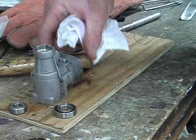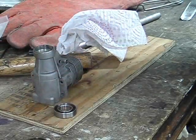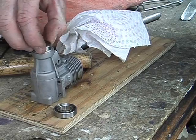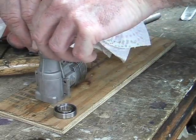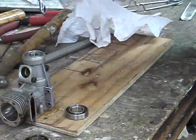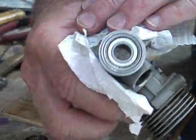Put your engine down on the piece of wood, get your bearing, and press it in evenly. Try to keep it level — if it goes slightly on an angle it'll be hard to get in. Give it a good push, and if it won't go, heat it up. Alternatively you can tap around the very outside of the bearing with a small hammer. Do NOT tap the inside piece that rotates — tap only the outside of the bearing, being careful not to damage the crankcase casting.